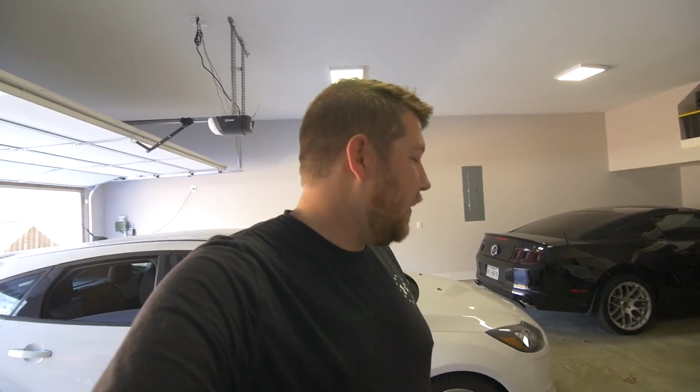So that is shift knob, Access Port out of the way. Next we're going to remove the Turbo Smart blow-off valve and put my Mountune bypass valve back on. That's the one that came on the car, so while it's not a factory piece, it did come on the car like that to me, because this does have the Mountune upgraded kit. I think it's the P275 kit or something, intercooler, intake and bypass valve and some couplers and charge pipes and stuff. So jack this up, passenger side wheel.